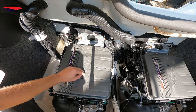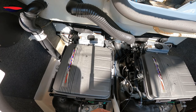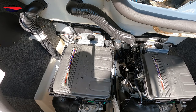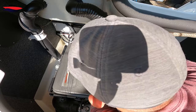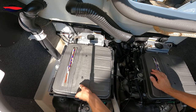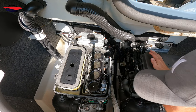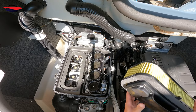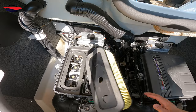The first thing we need to do is loosen up these screws and slide these things off to remove the air filter box — there are bolts in the back too. Now that we have that done, we need to pull the air filter out. While we have it out we should take a look at it — hey, it looks nice, like a good air filter should.